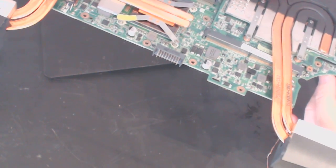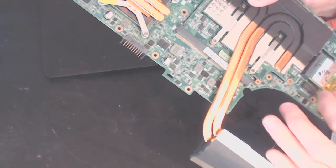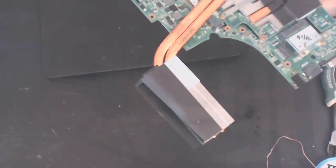So we got all the holes empty so that you could see through them. And now once you can see through every single hole, you can put a new jack in. The problem here is that the top trace for the positive is damaged. And because the top trace is damaged for the positive end, we have to do some other stuff here.